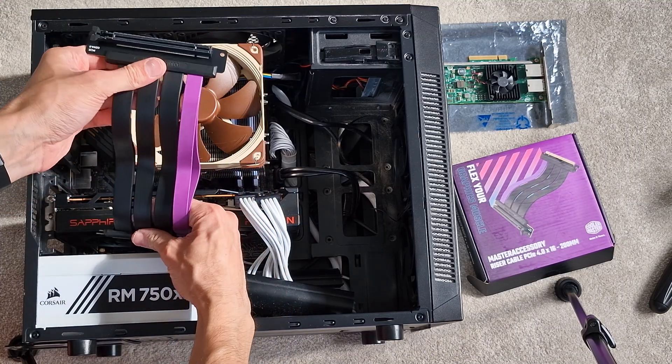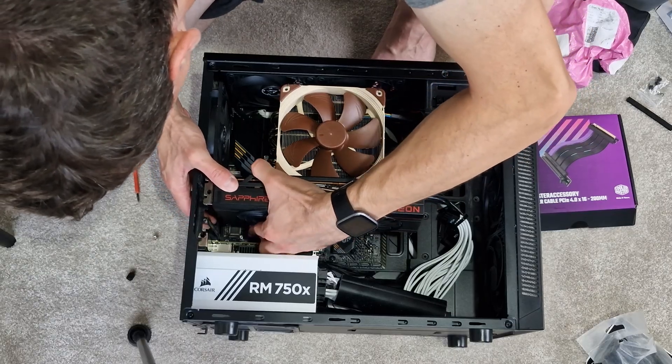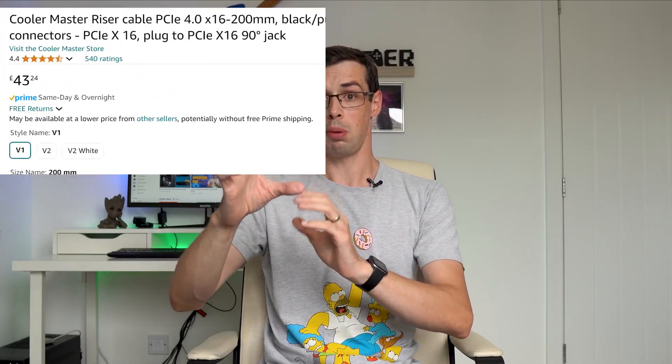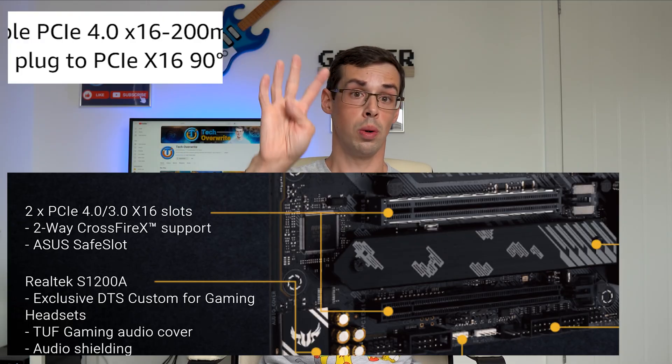You'll either need to make or buy a custom mount, or try mounting your GPU to your case with cable ties and GPU support brackets, which is a bit chunky. This is actually what I ended up doing in my workstation PC to finally get my 10 gigabit network card installed, but it's not a great fix. The second thing to know is that riser cables aren't always cheap — sometimes you can spend £100 or more. Finally, while PCI Express is meant to be forwards and backwards compatible, in practice you should buy the same version of riser cable as your motherboard — for example, if you have a PCIe Gen 4 slot, buy a Gen 4 riser cable.